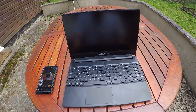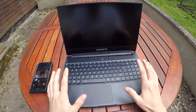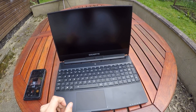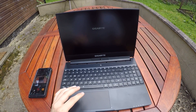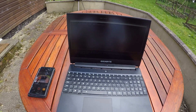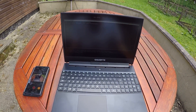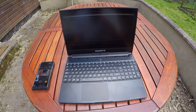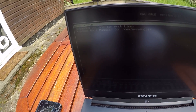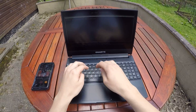After some painstaking work, we've managed to get Linux and Windows on this laptop. I had some issues with the Nouveau drivers under Linux, so it was necessary to blacklist Nouveau and just run with the Intel video drivers. I haven't tried getting the Nvidia card working with Linux yet, but I don't think I'll need to. We now have the option to boot into Arch Linux or Windows, which is great.